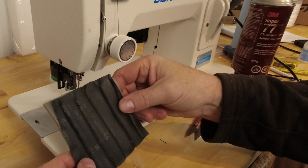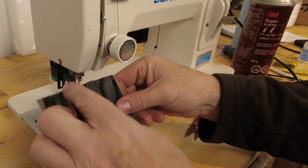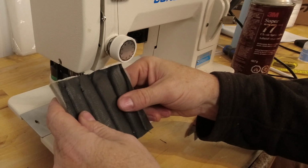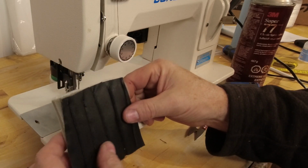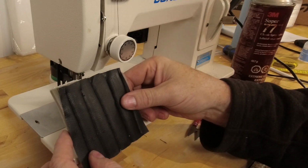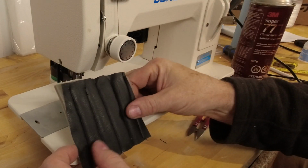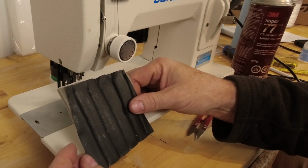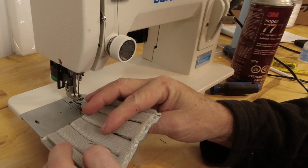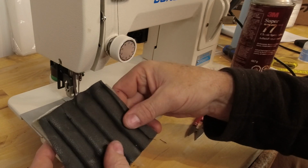That is a pleat. And when you actually know what you're doing and you're able to make the seams go straight instead of curving like that one does, you've got what's called a pleat. And that gives you a nice texture. You can put it this way on your seat, you can put it this way on your seat. Makes a nice panel. Essentially you make a panel as big as you need it. If you're going to do a seat back and a seat base, you do them at the same time, one big panel, and then cut them in half so that the pleats line up. And you then build the rest of the flat upholstery around it, and you have to decide whether you're going to use the sew foam or just the bare vinyl. But that's really neat how that's turned out.